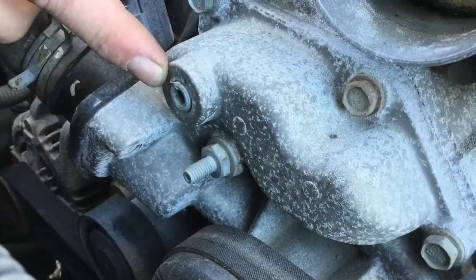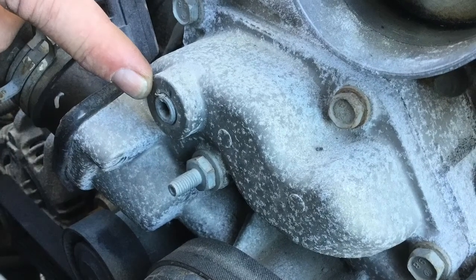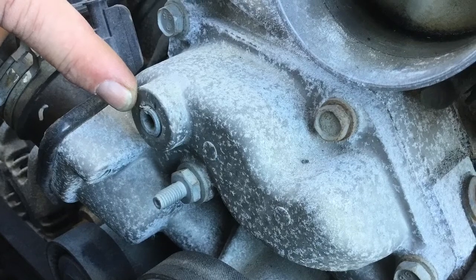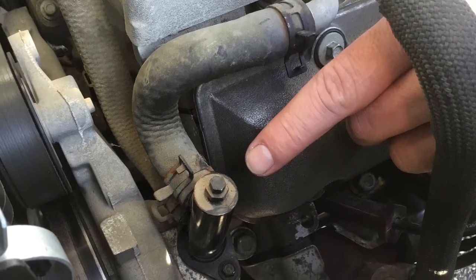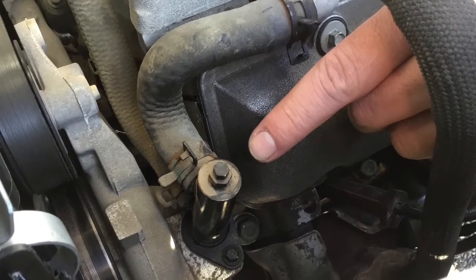If you don't have access to a coolant lift, several vehicles are equipped with a bleeder screw that you will be able to find through OEM information. While filling the coolant, the idea here is to take the plug out, fill the coolant, and the air that is going to be in the system will be pushed up through the vent as the coolant enters the system.